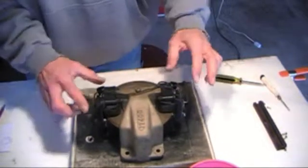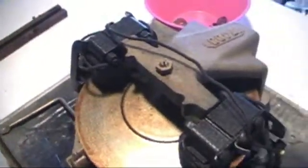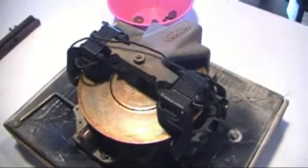The first thing I want to do is remove these coils. The coils are held into place with three screws — there's one at the top here with a little tab on it to hold that wire, there's a screw, and then there are two at the bottom on both sides. As we loosen those up they should pull out and away from the frame.